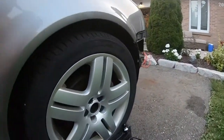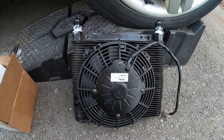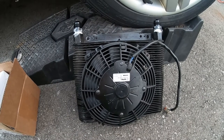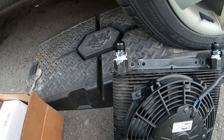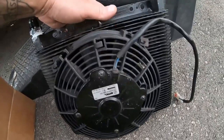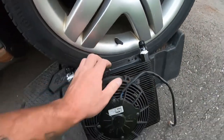Let's take a look at what we got. This is our oil cooler — it's a universal unit. I'm actually not sure of the brand; I got it used from another person. It was originally for the I-Rock project but since we got rid of that, this is what we're dealing with. It's got two half-inch MPT fittings, dash 10, pretty standard. And then we have a Spal fan — I'm not sure how much CFM it pulls but as long as it works, that's all that matters.